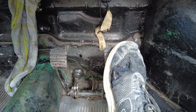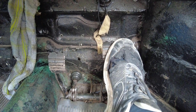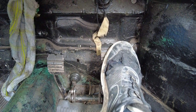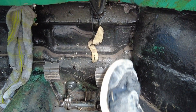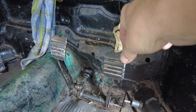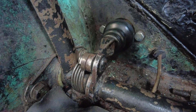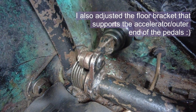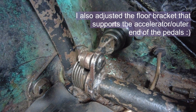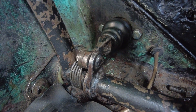Once you get to the hard firm point, you've got about two inches of travel, which is more than it used to be. It might take a little bit of getting used to, but once you get to that point it's full-on braking. Taking most of that movement out now - most of the movement is actually in the pin that goes through the push rod. I'm not sure if that's because of using a different push rod from the 944, but I'm going to look at sleeving that just to take that little bit of free play out.